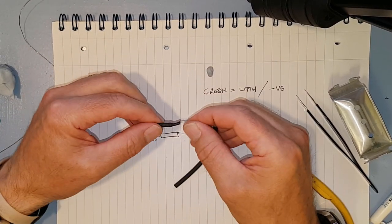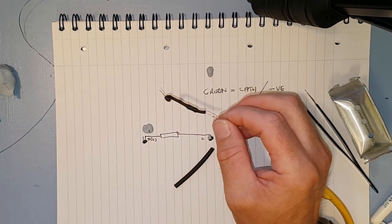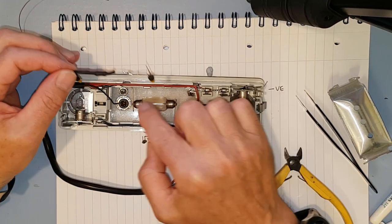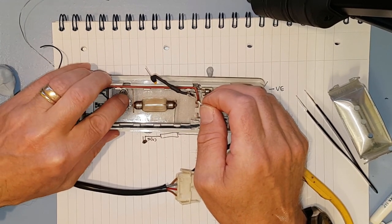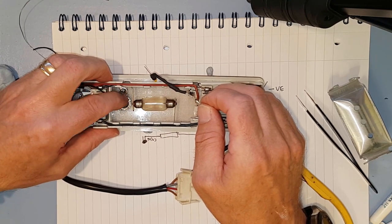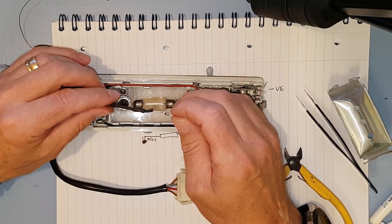So there we go, that's the way it's going to go round. So we can get our thingy bob here. So this is going to go over this bar here. And then we need to solder this leg onto this terminal of the potentiometer. Probably best if we have it directly upwards. More chance of getting the LED in there.